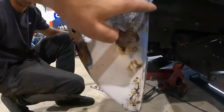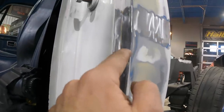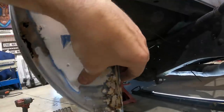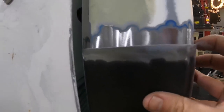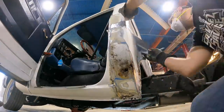The edge of this flange is completely rotted out. We're going to start separating this from the inner shell — this is a spot weld seam right here. These little divots are spot welds, and if this wasn't all rotted out you'd be able to clean the metal off and see all of them. I'm going to mark a rough line lower than where the seam is actually going to be, cut it, drill all the spot welds out, and get a bulk of this old nasty metal away. Then we can take our new cap, put it over, and there shouldn't be anything holding us up.